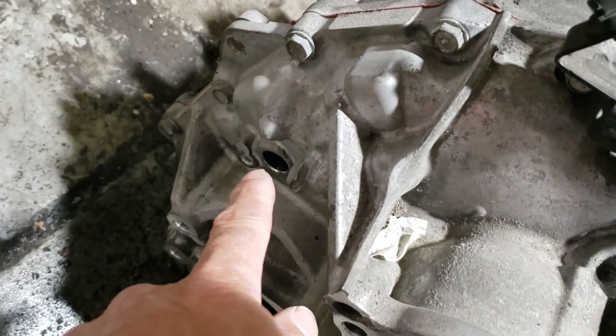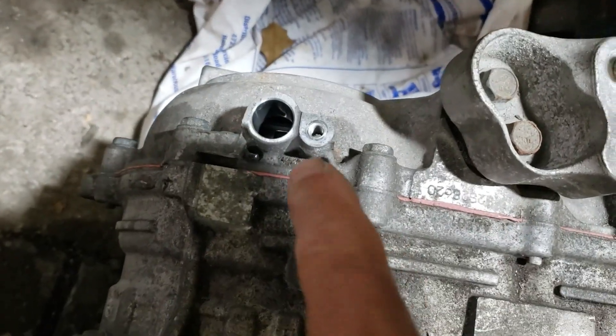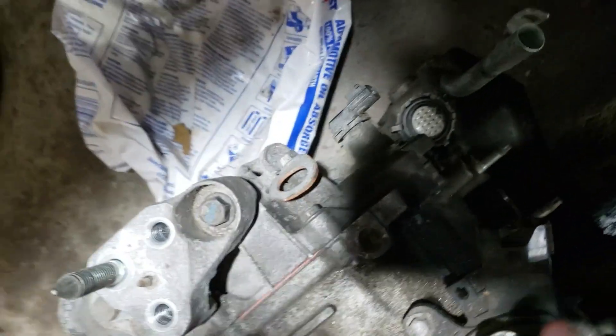What was challenging with this vehicle is the flow charts for the trouble codes, the service information, and the wiring diagrams all name these components differently. There's a vehicle speed sensor, a transmission speed sensor which is the output speed, and an input speed sensor - three sensors total. In some documents they were called 'primary speed pulley' and 'secondary speed pulley.' These two sensors were actually plugged in opposite to each other - the plugs are identical, so it's a very easy mistake to make, but it was also an easy fix. Have a great weekend, everybody!